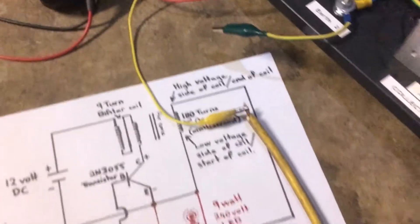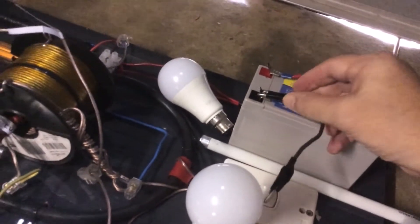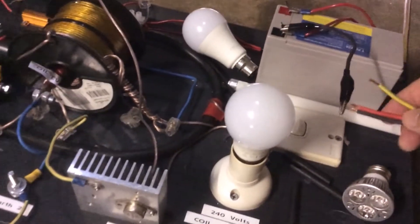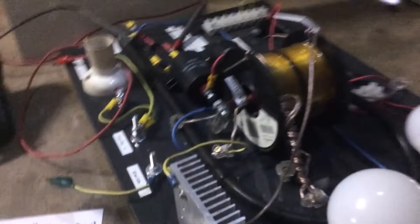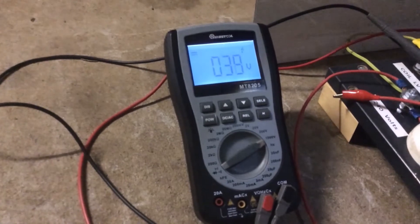That's just the one earth wire. If we take that off, we've seen what one earth wire does to the negative. We can place an earth into the system — I'll do that with a jumper lead so we can watch the meter. All right, so we have that connected and now that's saying 39 volts.